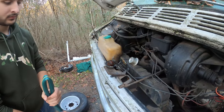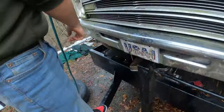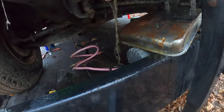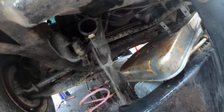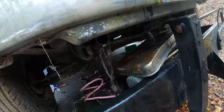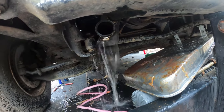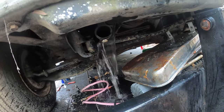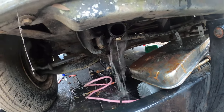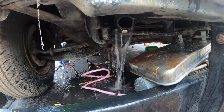Right now we're entering the hose through the top of the radiator and it's coming out here, flushing all the old coolant — all the bad coolant that's been in there for a long time. We're going to do that until the water looks clearer and clean. The radiator should now be flushed. Over time when the car heats up it will break down more, so it will be good to change the coolant again in another 1,000 miles once we get it running and driving.